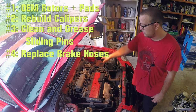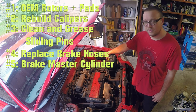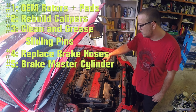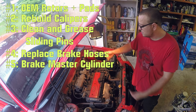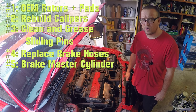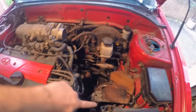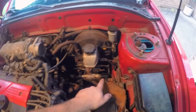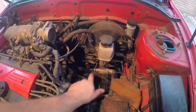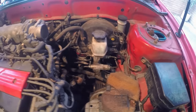So what it comes down to is the brake master cylinder. My theory at this point is that either the lines are clogged or the seal is worn, and for some reason it's just not accepting the fluid back. I got a new brake master cylinder from Rock Auto for like 60, 70 bucks. So we're going to be swapping that today. This is what it looks like — I've removed the intake to make space, and I've already cracked these bolts. Had a bit of a struggle with this one — it's mangled, but don't care.